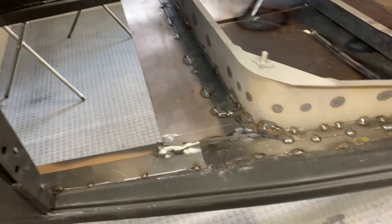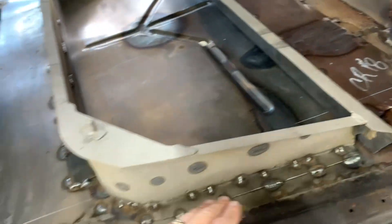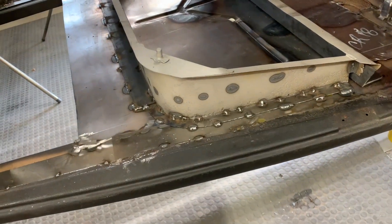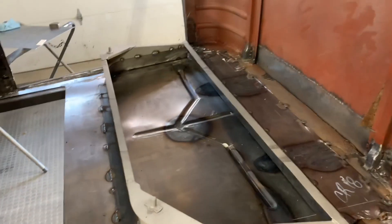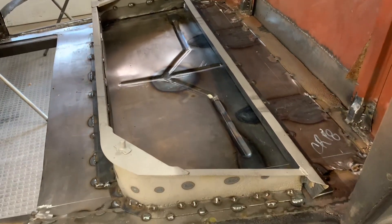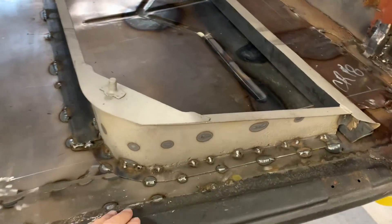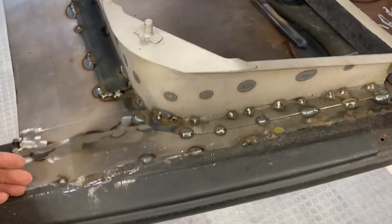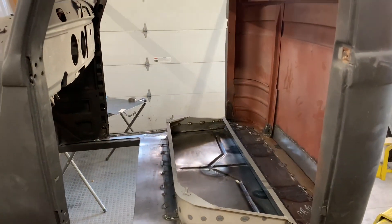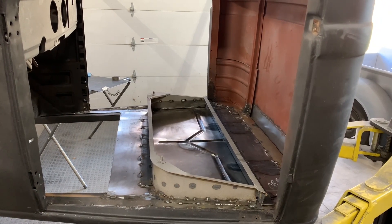I kind of just stitched it in - I'm going to weld everything up, including back here and all this down here. I'm going to grind it, might skim it in a few spots to smooth things out, and then seal it up. That's basically the floor and as far as I'm going to go with this video. Next video I might just run around to show how much further along it is. I expect none of this will ever be seen because it'll be carpeted - the carpet is probably going to come right up to this lip here. Other than pulling a few more things out of this cab, this cab is almost done as far as metal work goes. Hope you enjoyed - subscribe, like, all that happy stuff.